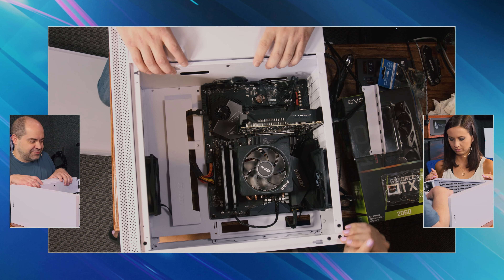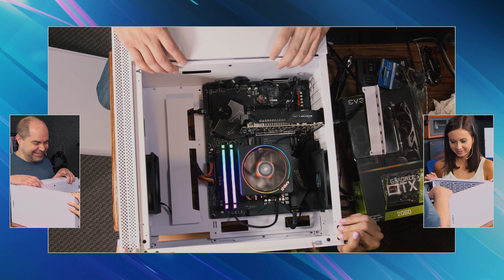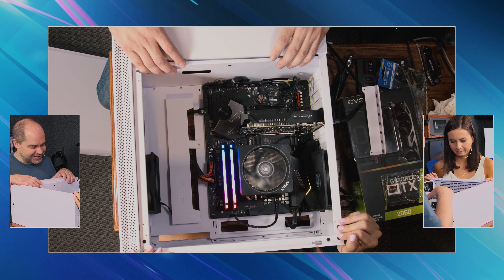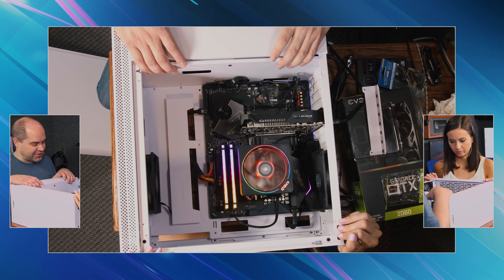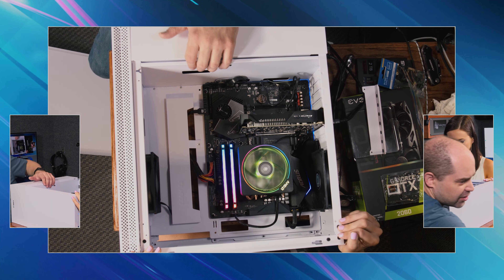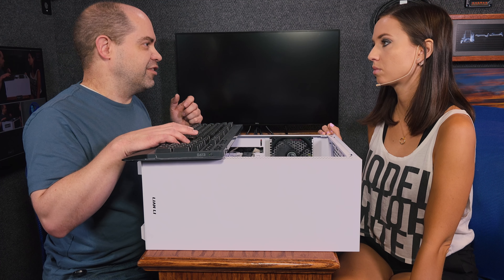Let's test. Go ahead, I need to turn that on. We have more colors, and it changes. That's so cool. You'll be able to set all the colors. So make sure it's going to come up. Might as well do it now. I think we're ready to test it — hit the power button. I'm going to go into the settings for the motherboard and tell it that we need to run memory faster than its default speed, because for some reason by default it runs about two thirds of the speed that it's supposed to. Your memory is actually a lot faster than what it tries to run out of the box.